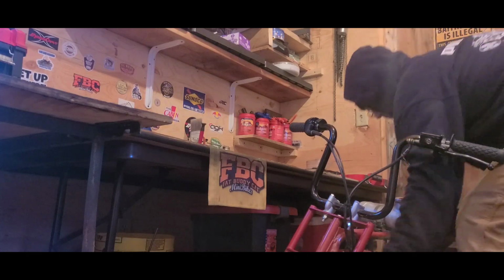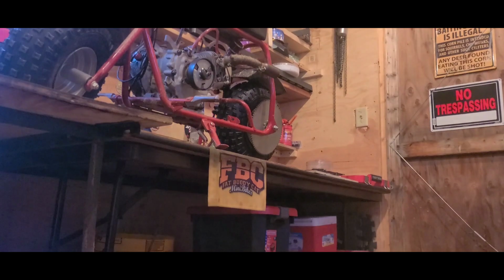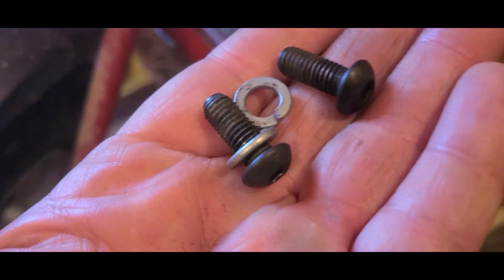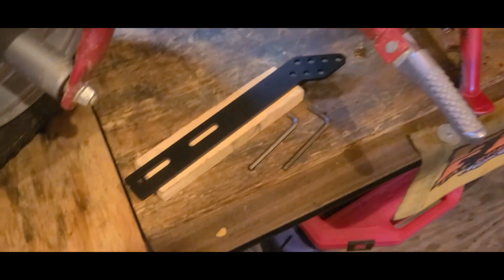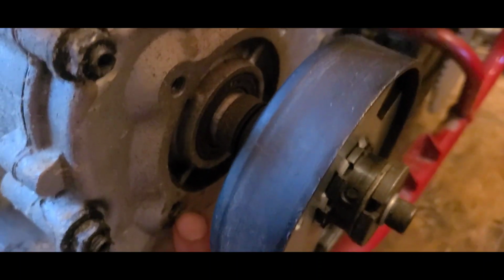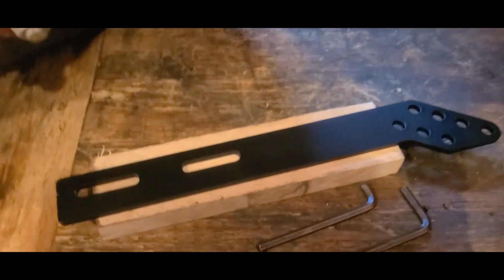Now the mini bike, go right up on the bench. And we can move forward with the installation. I'm using 2 hex cap bolts with lock washers on them. These are going to hold the frame onto the side cover using these lower 2 mounting holes. Typically that's something you might use for, like, your torque converter. Well, not today. They're going to be for our tensioner.